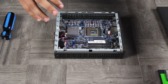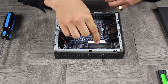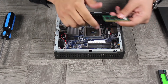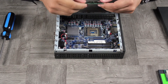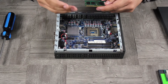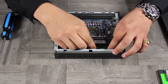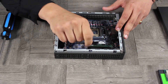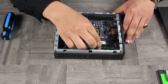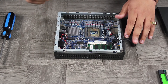I personally like installing memory first. Keep in mind you must know the specs of the unit beforehand — this uses DDR3L memory. There's a notch on the module and a notch on the slot, so they only go in one way. Don't force them. Also note that DDR3 and DDR3L will physically fit but won't post because they use different voltages. Slide the DDR3L module in, make sure all the gold contacts disappear, then press in and down — it snaps into place. If you've upgraded laptop memory before, this process is identical.